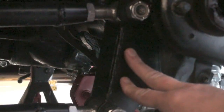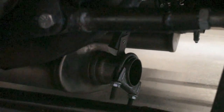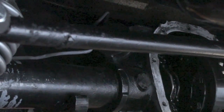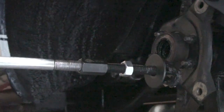The only thing you had to do was weld on the brackets to the rear end. This bracket right here is a bolt-in bracket, though I'll probably weld it in when I get access to a welder. The only problem with the four-link and panhard bar is it limits your rear exhaust options — the panhard bar sits exactly where the rear exhaust tailpipes used to come up and over, so you either go under or do exhaust dumps.